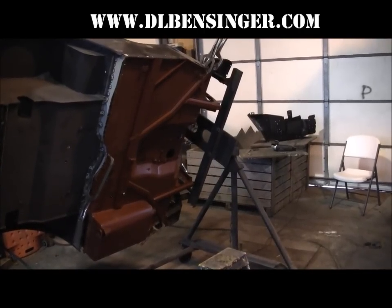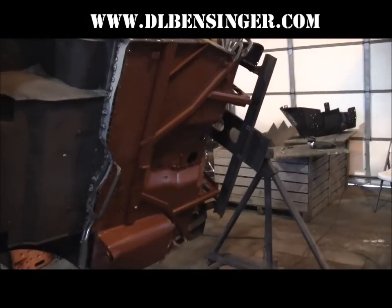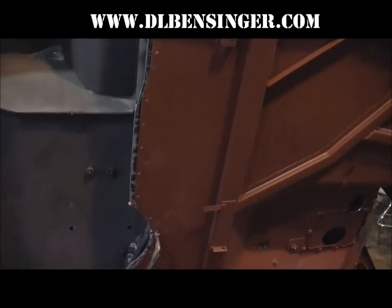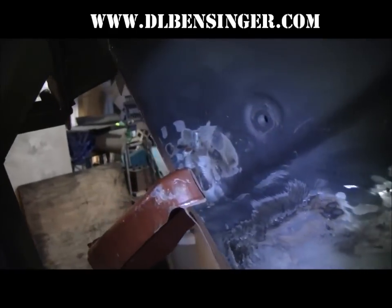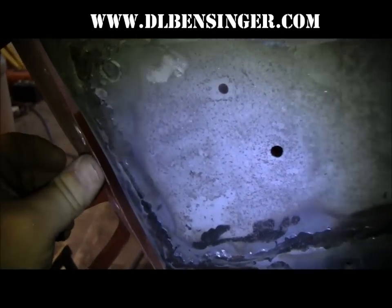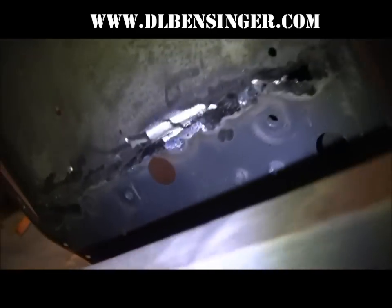At this point, I've gone ahead and fitted the floor into the body. And what I need to check next is just how well it fits. In the back here, where we're going to do the plug welding, looks like we're in good shape. In the front firewall, fitting pretty good. There's a few areas here that we'll draw up when we go to bolt this. We'll be able to pull this up. That'll work okay. That's not fitting too bad.